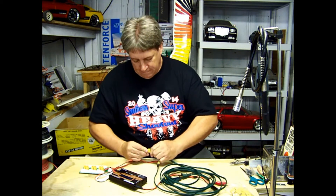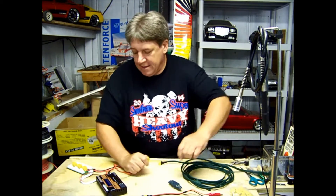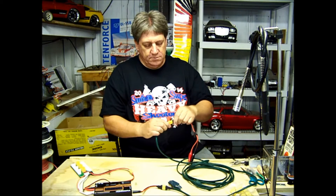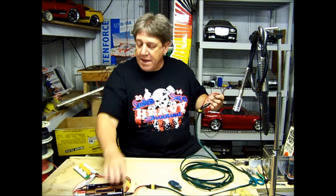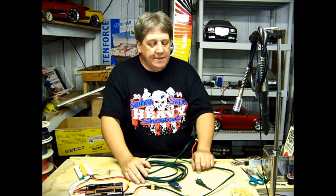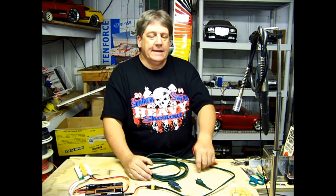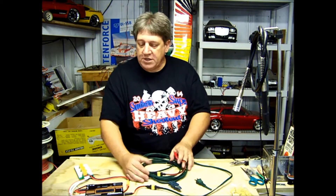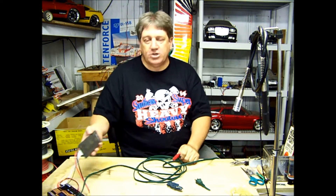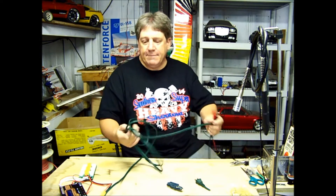So now you plug this into here, you plug this into here — and now when this is hooked to the car battery, I can move this and my battery that I'm charging is 16 feet away from the car. I also have a little folding table I'm going to show you, available at most outdoor stores like Dick's Sporting Goods or Sports Authority. You can set this up on your table 16 feet from your car, and now you're safe. If the battery you're charging blows up or catches fire, it's far enough away that your car is not going to burn to the ground.